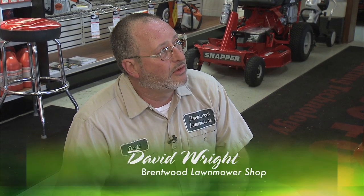A 25-hour interval, most people will use a walk-behind mower like this about 25 hours a year. So once a year service as far as oil change and possibly air filter service is generally good enough to keep the mower in good working order. But oil changes are critical. Also, engines will use a little oil. Even an engine in very good condition will consume some oil, so you need to check it frequently,